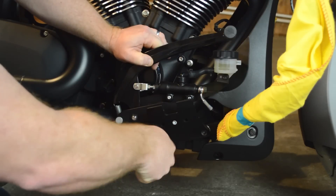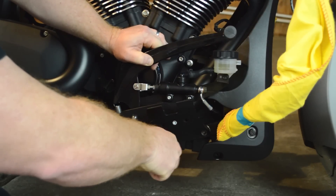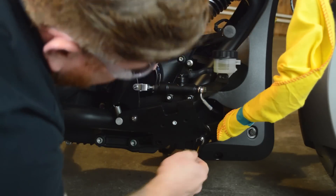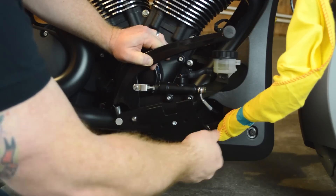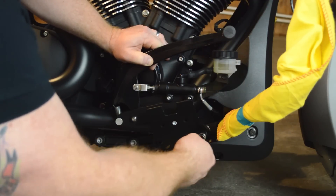I like to support this bracket just a little bit — you don't want it moving around and smashing into the exhaust. So just take your time as you take everything apart here. You can see that I've masked off the highway bars there, or your crash bars. That's just going to keep this from scratching anything as we're moving this bracket around.